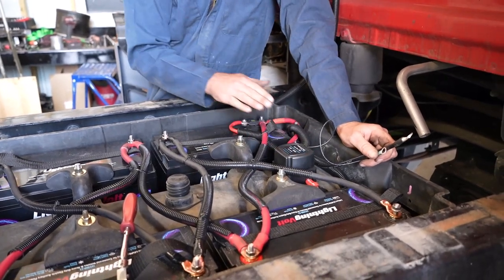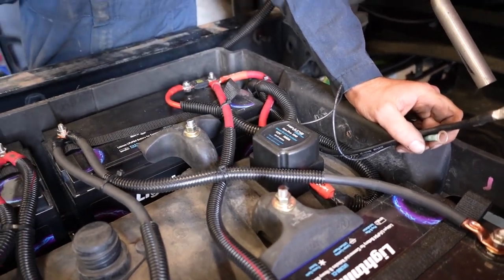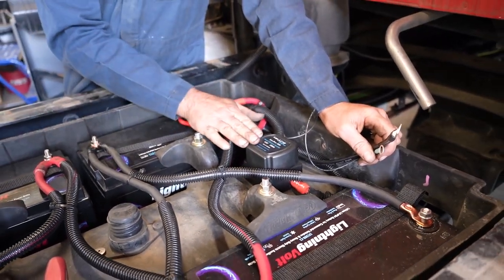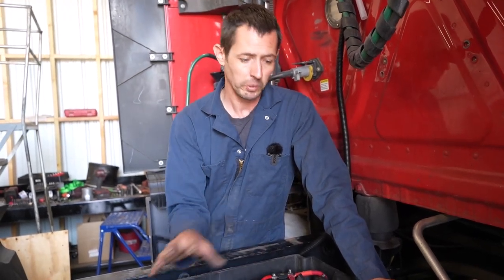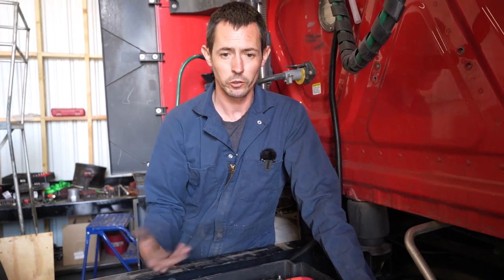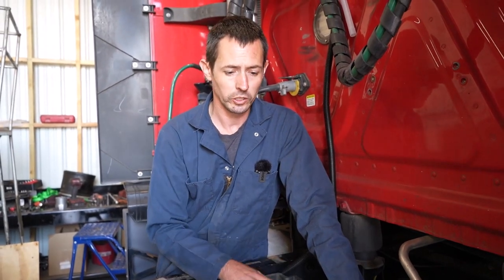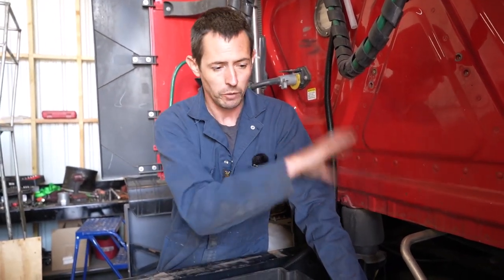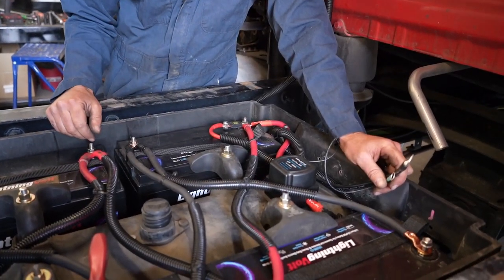The other feature we've put into this system is a battery isolator, or a smart battery isolator, or a bi-stable relay. This is a 300 amp unit. What this does is basically isolates this bank of batteries from your starting batteries, because you don't want this to draw down your starting batteries — next thing you know, you've run all your batteries down and you can't start your truck. This has a cut-in and cut-out, so it'll charge off of your alternator and the other batteries. Once these batteries get drawn down to a certain level, it cuts this off so it doesn't draw from the starting batteries. That's a pretty common feature you're going to see on most of these types of systems.